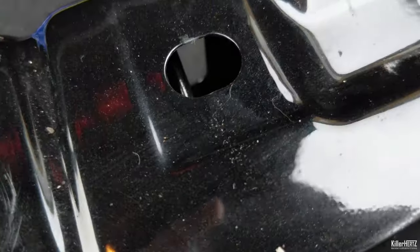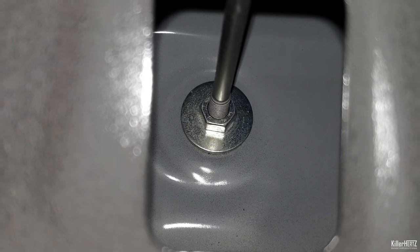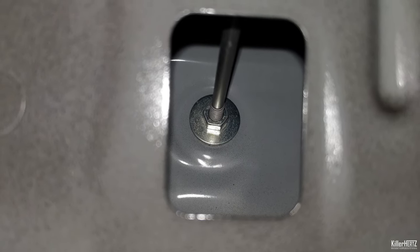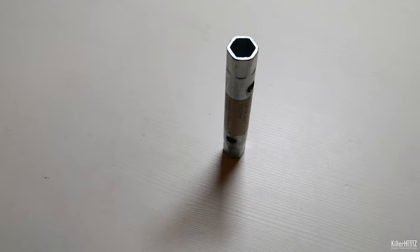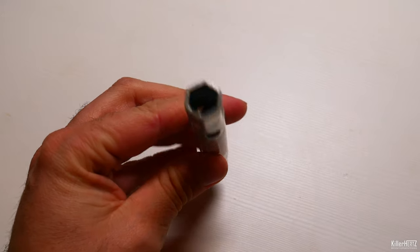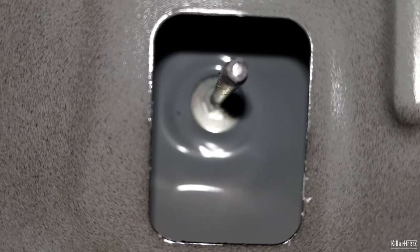Afterwards you'll be greeted with this peculiar bolt - something which I've never actually seen before. The nut is held in place on a metal rod which is around 10cm long, and the rod can be moved around inside the cavity but it's stuck right against the chassis and you can't remove it. Does anyone know the actual point of this? If you do please leave it in the comments below. This really perplexed me - how on earth was I going to get this nut off when I couldn't even unscrew it? A quick trip to my local hardware supplier offered a solution. A spanner box allowed me to loosen the nut, and a hammer and screwdriver did the trick by exposing the end of the rod, allowing me to free the nut and remove the bumper.